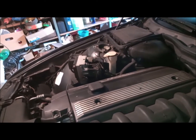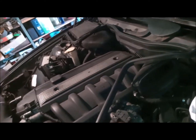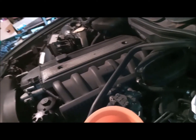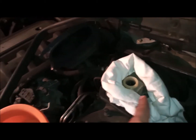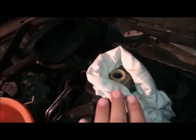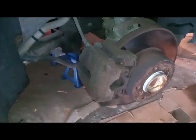The second thing, some people like to take the old oil from the reserve and fill up the new oil. Of course, if you do this, you will compromise your ABS system, because it's all connected. All the lines, if you can see, go to the ABS between the minimum and the maximum level. So I wouldn't do that, although it will cost me just 5 or 10 minutes to wait for this oil to bleed out. I would rather wait, because if air bubbles go to the ABS system, I'm done. I have to go to the dealer, and they have special equipment to zero everything and test everything, which I can't afford. It's very expensive equipment, so I would rather leave everything as it is.